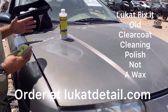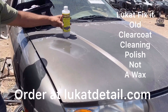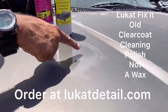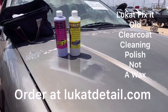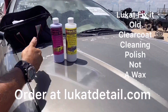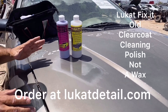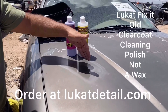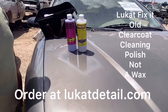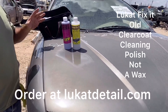It's still intact — look how beautiful that comes out. Do a close-up so they can see the sparkles on that thing. This is the original state; it's going to take years to oxidize because I cleaned it and sealed it. Here's where people get confused: that's a cleaner, that's a sealer. To bring back a paint job like this, there are great waxes out there. Now you can wax this because it's smooth and glossy again — but before, it was toasted, brittle, and falling apart. Clean it, then seal it.